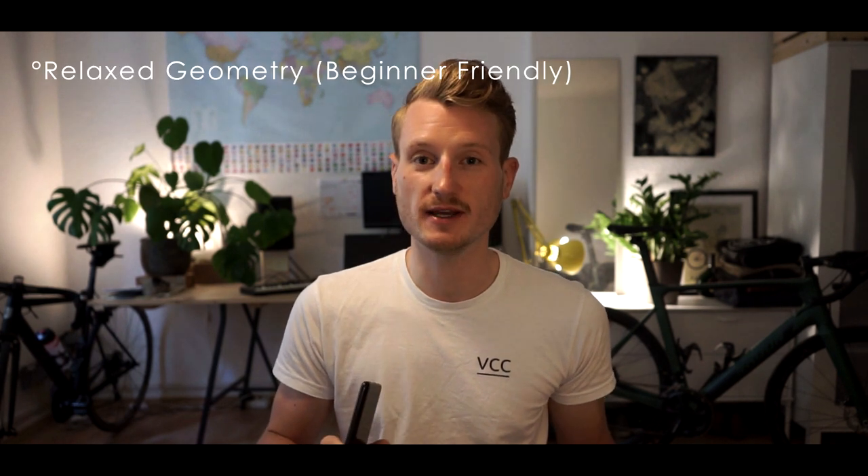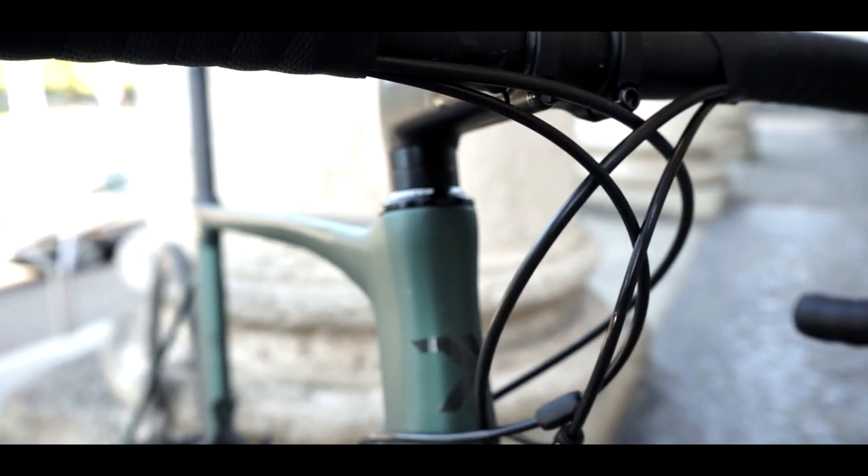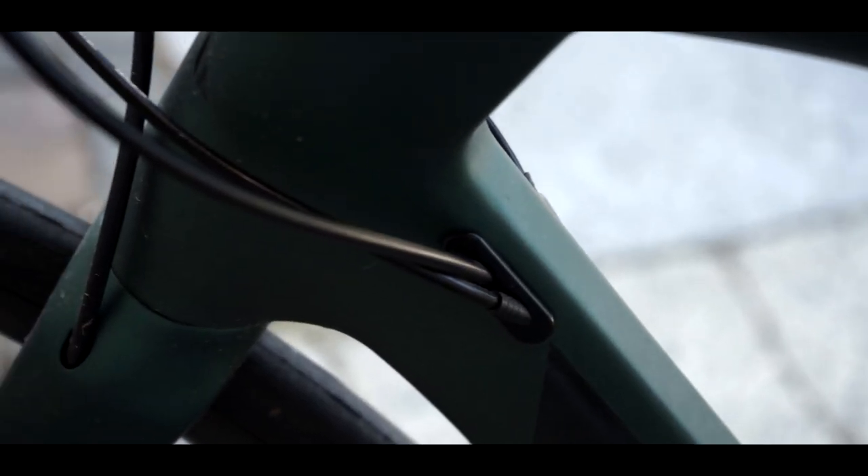The bike position and geometry, at least for me, was very upright. This particular bike frame is for my friend who is a very tall man and I'm a bit smaller — this ends up being an L frame size and I would go with an M or even S. It was not very racy for me. I also noticed the different crank length: this one has 175mm while my Rose has 170mm and I really noticed the difference in rotation radius. Additionally, going over rough terrain, all the cables in front that are not integrated are hitting each other and the barrel adjusters there were making a lot of sound.